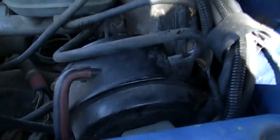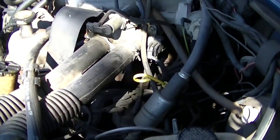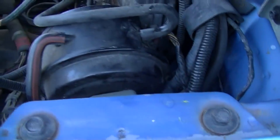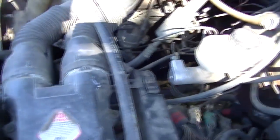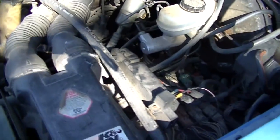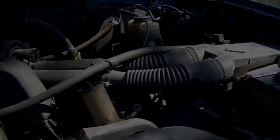So my diagnostic is maybe it might need a servo. Before I put a servo on it, I will put a throttle position sensor on it. Maybe cleaning the connector may have helped it. I don't know. We'll find out anyway. When I get time, I will go ahead and dismantle it and check the continuity, check all the amplifier circuits also. But that is my preliminary diagnosis anyway, is the servo.